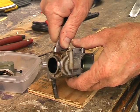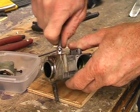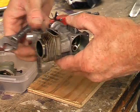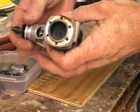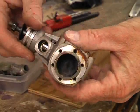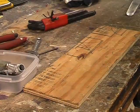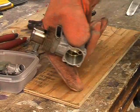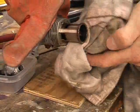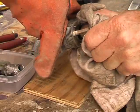If that's still not enough, we have to use the second method: applying heat to the crankcase. First we must remove the carburetor because it contains o-rings and other pieces that may be damaged by the heat. Loosen the cinch bolt, give it a little tap, and the carburetor should come out easily. Then put the engine in an oven at 250 to 300 degrees Fahrenheit. Back from the oven now — holding the engine with a glove, it just requires a little bit of a twist to get that liner out. Take it carefully and slowly, and with a little bit of work, out it comes.